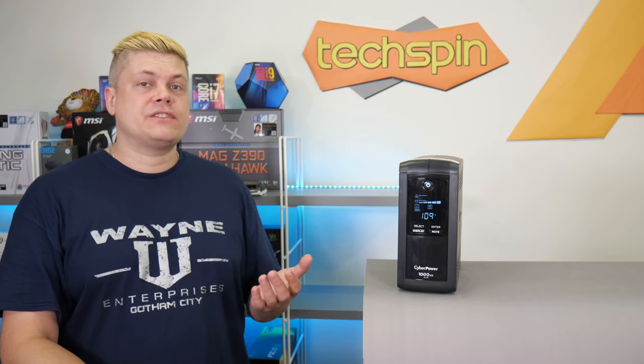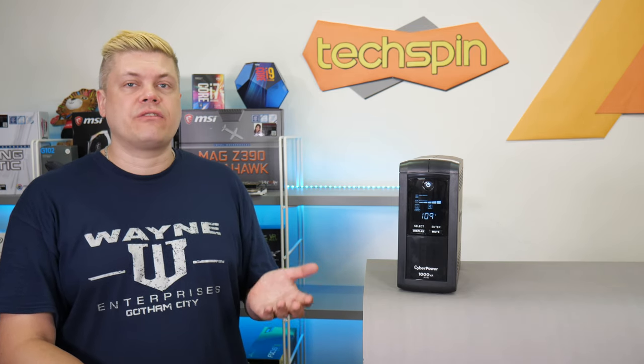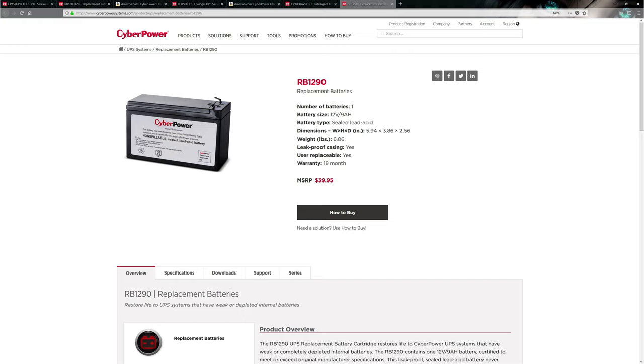This CyberPower unit has a surge rating of 1080 joules, double the previous model. Battery recharge time is typically 8 hours from empty. Battery life isn't listed but should range also around the 3 to 6 year mark. There's audible alarms for battery mode, low battery, overload, and fault conditions. And there's a user replaceable battery for a list price of $40 when you eventually need to replace it.